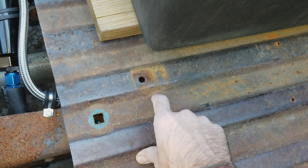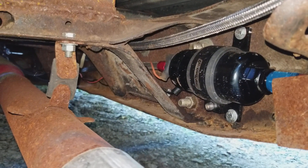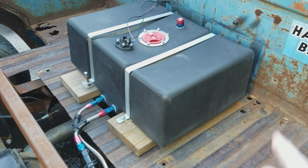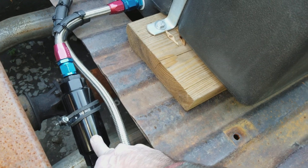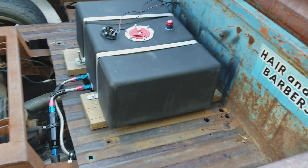Let me come around the other side. My fuel pump is literally right here on the frame. There's my fuel pump — it is brand new. This is the same exact one; it's a kit that is made for this FiTech system. For some reason I don't think it's the pump — I think I'm cavitating. I believe that's why I stalled out; I'm not getting enough fuel through here. But I don't understand why it would stop all of a sudden — what is keeping me from getting fuel?